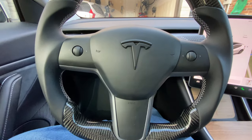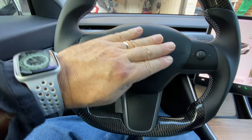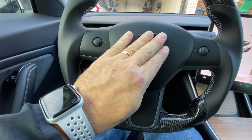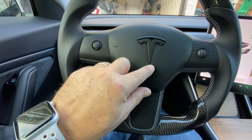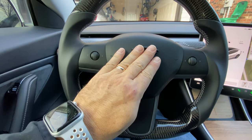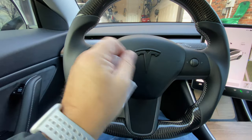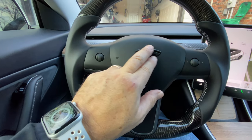All right, so there it is on. I actually held it down for a couple of minutes, and I find covering everywhere that has the tape, as much as you can with your fingers while you're holding it, the heat from your fingers will help transfer heat to the glue on that 3M tape. Just a little trick. So the longer you hold it, the better. You don't necessarily need to heat this up with a heat gun. It probably wouldn't have hurt to do a quick blast just to get the tape a little tackier. But doing that with your fingers will heat it up.